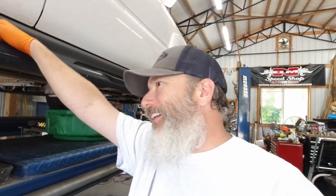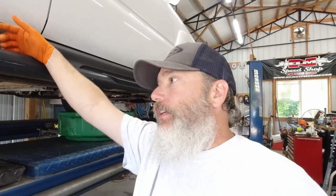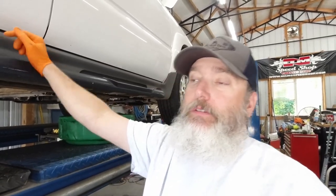There's enough carbon here to cook a couple hamburgers on the charcoal grill. I mean, dang. I blew a ton out before when I put the new charcoal canister in it, and the vent valves and the purge valves. So I blew a bunch out of that new charcoal canister too. So I don't know if it was put in there because of stuff in the lines, or if it's already breaking down. I doubt it's already breaking down. It's only like a month old.